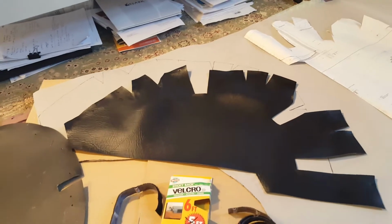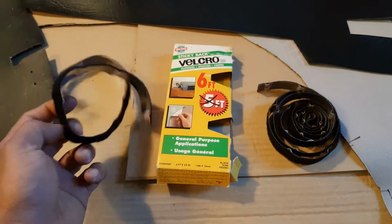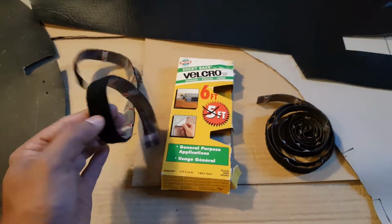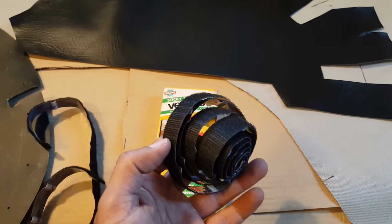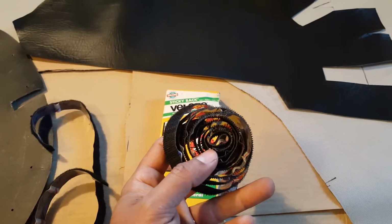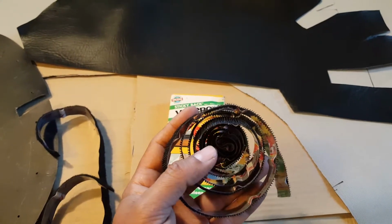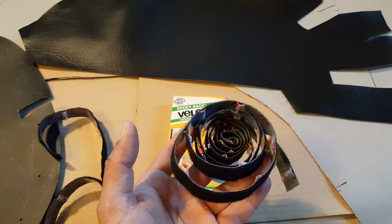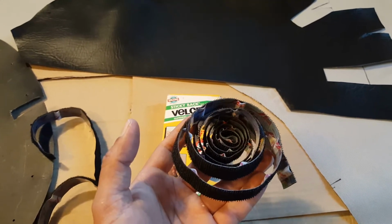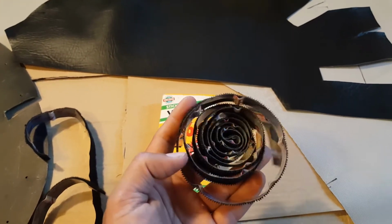And in order to install this, I've gone ahead and used Velcro strips. This is the one with the sticky back. So the sticky end, that is the harder plastic portion of this, is what I am attaching or gluing onto the crash bars. If down the road I ever want to remove this, it's very easy to remove the adhesive from the crash bars because they're chrome. So any type of paint thinner will work in removing it.